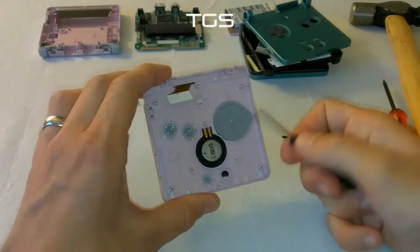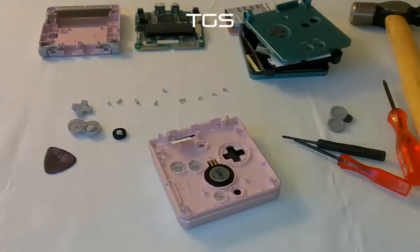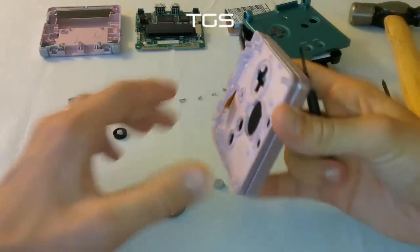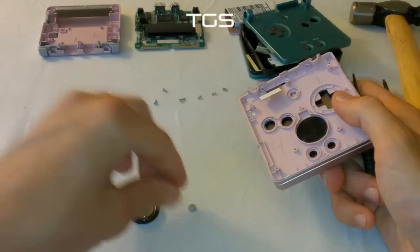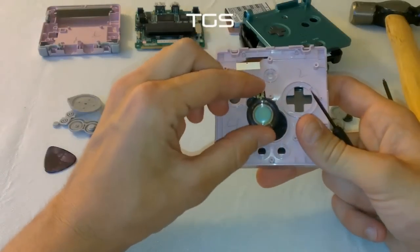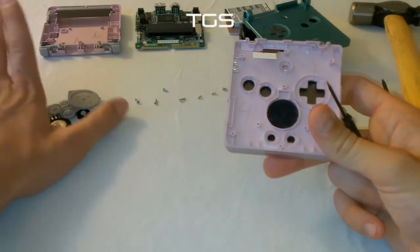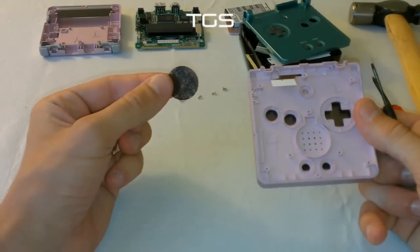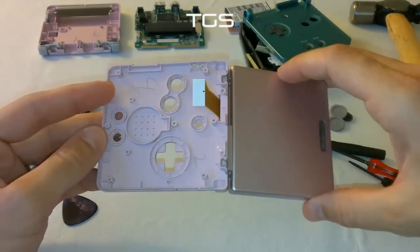You've got the left button, the D-pad with the D-pad cover. Just poke them through — if I tap that out you can see they just fall out. You've got the A and B buttons there, and the little backlight on/off button. The last thing is the speaker. So take all that and pop it to the side, including the speaker cover. What you're left with is the rest of the Game Boy empty, with ribbon.